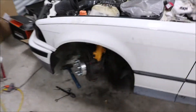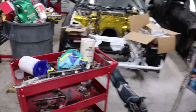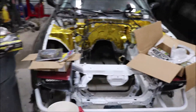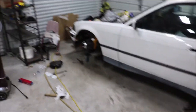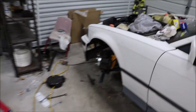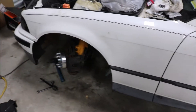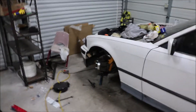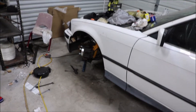Version 1 kit gives you quite a bit of angle for a BMW — now it's no 240. My 240 has close to 70 degrees of angle; you're not going to get that out of this kit, but you are going to get close to 60, which is pretty good, especially for a beater car that doesn't have a lot of horsepower. That's all the angle you really need — you don't need to be hitting 70 degrees when you don't have much horsepower, because it'll die out pretty quick.